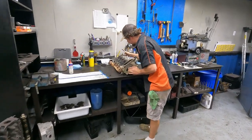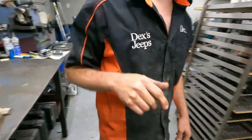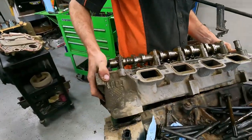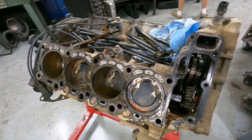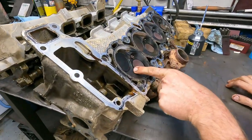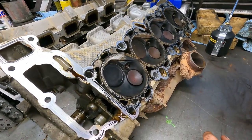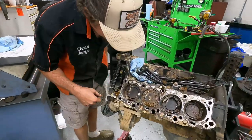It didn't drop any seats so far on either head. I think it's just severe overheating — it smells terrible. That head's the known bad one — they've already been in there. You can see the different discoloration. That valve is mushroomed differently from the others — they replaced this one. Yeah, this head is a reman. Everything looks like Justin can fix it, but the exhaust is rusty on the inside.